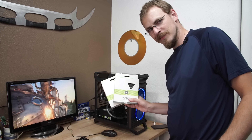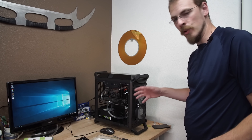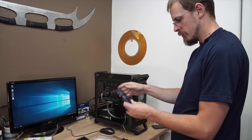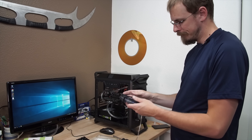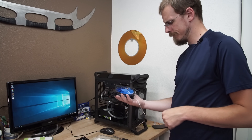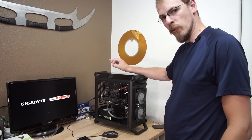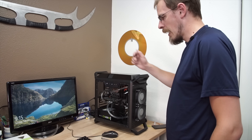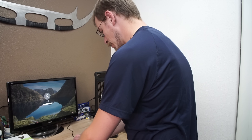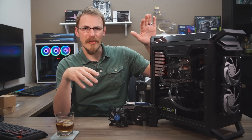These replacement fans ought to do the trick. Now there's actually air coming through the radiator — still not a ton, but these fans are also not moving that fast. Those deep cool fans — I don't think there are deep cools — those things just don't move any air. They don't even suck, they don't even blow. They're just terrible. So I dialed in a little bit more aggressive fan curve: the fans will hit 75% at 40 degrees and 100% at 60 degrees. Now they're actually spinning, I can actually hear them. Still not louder than that pump though.